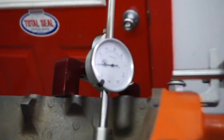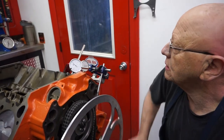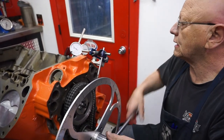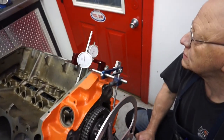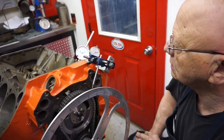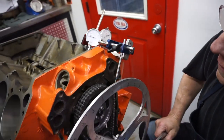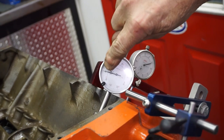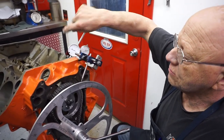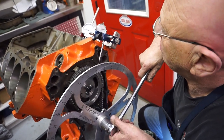Now you come back up here to this — 135. Then you're coming up on the zero mark, the highest point of the cam. 50-thousandths before the peak of the camshaft, and you take this number here — 76. Then like 75.7.